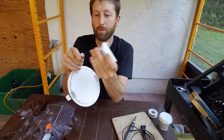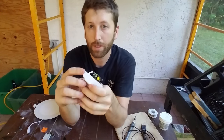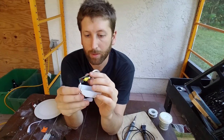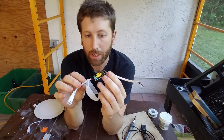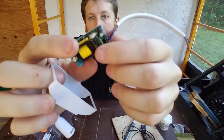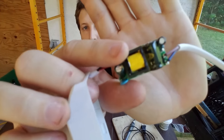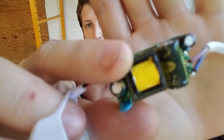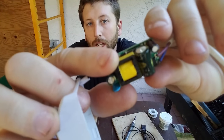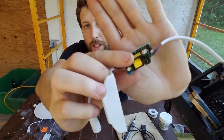So you can move this part here. This is the LED — this is still good. This is the power supply, or whatever they call it. Basically, as you can see, there's a little transformer here and there's a capacitor. And on the capacitor, it's kind of hard to tell, but it's kind of puffed up right here. The top is kind of puffed up.